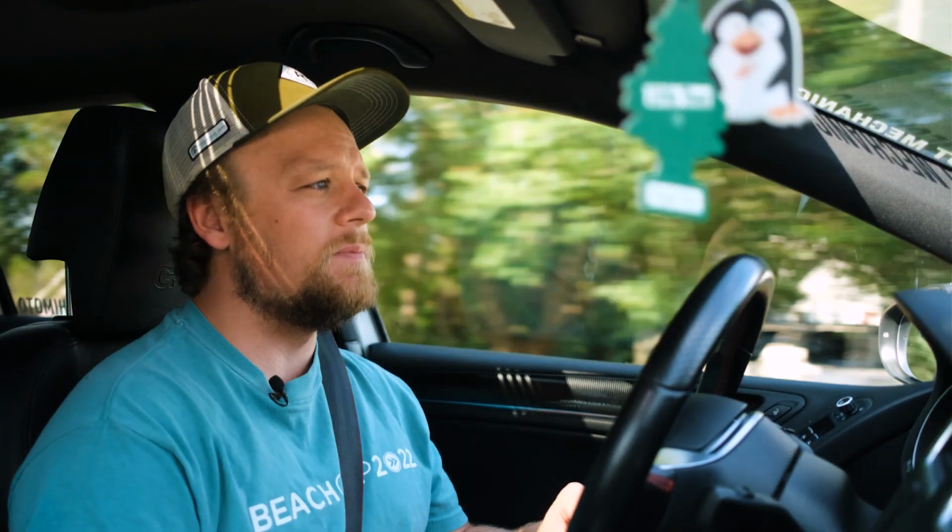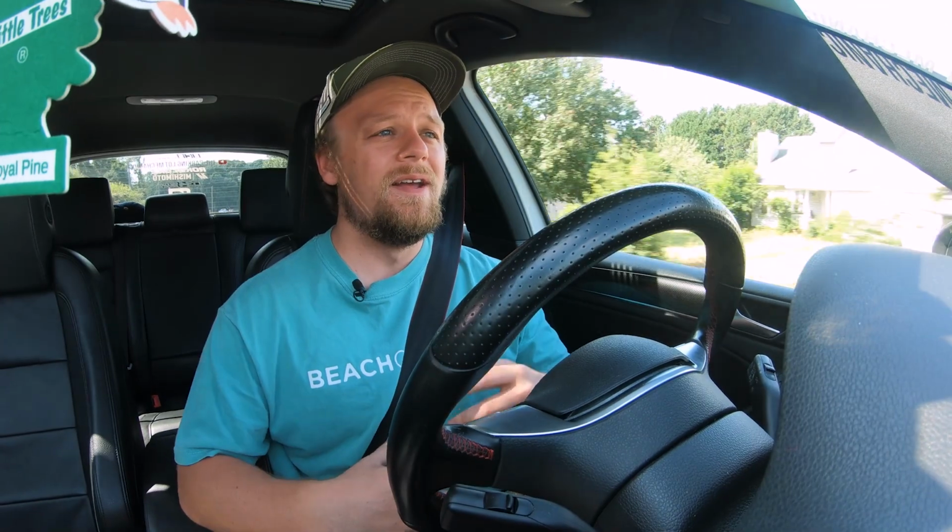Now I have the Rev9 Catback exhaust, and James has the ECS tuning Catback exhaust, and he says his rattled a little bit too. So I guess it's just a fitment on these Mark 6s with the hangers. I mean, they probably dry up a little bit, contract, and raise everything up. The fitment on the stock ones I know is going to be really good, but we're trying to get a bigger exhaust on there than the one that comes from the factory. So fitment, of course, is going to always be a bit of an issue.